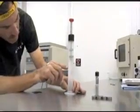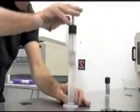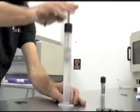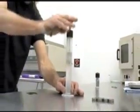Now you're ready for your rinse. Dump out the dirty alcohol from the initial wash and rinse out the tube. Fill with fresh alcohol to the 50 cc mark like before. Agitate bearings for 20 or 30 seconds and perform your rinse cycle.